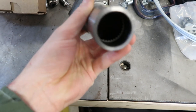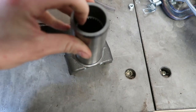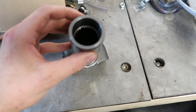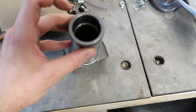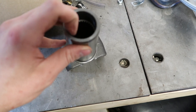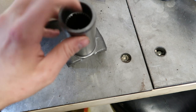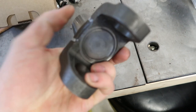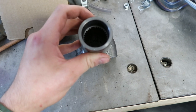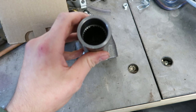Right here is where it's genius. You can see in here there's a counterbore that goes all the way down to the splines. This is because inside the transmission output shaft there is a groove with an o-ring on it, and that is to seal off the fixed yoke so fluid doesn't come out the bolt hole. We have to remove that o-ring in order to use this slip yoke, so that transmission fluid will go in and lubricate the splines.